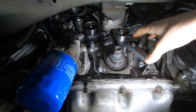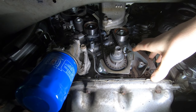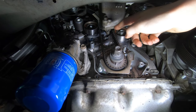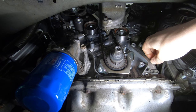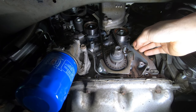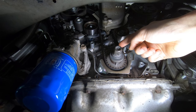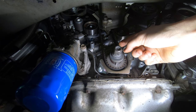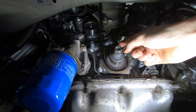After you get coolant in the motor, check the water pump — make sure it's not leaking. Ideally you should put coolant back in before you even put the timing belt on, so if it leaks you don't have to pull the timing belt back off. With this vacuum fill system, I was able to put vacuum on the system and verify it held vacuum. If it held vacuum, it's going to hold pressure, and if it holds pressure, it's not going to leak.